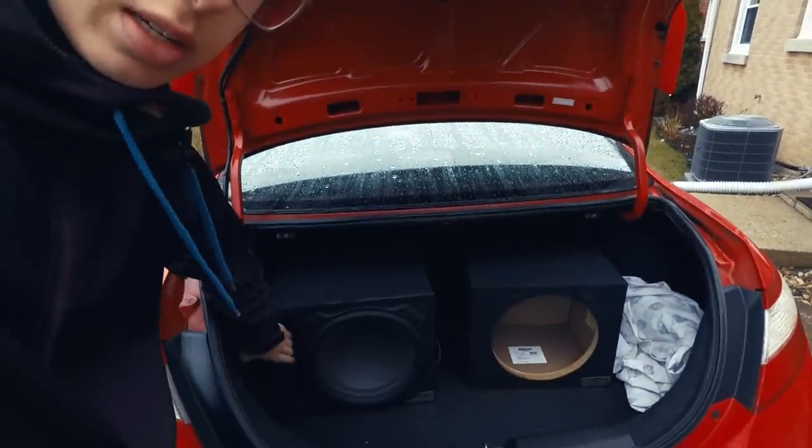One downside to a sealed box is that they are actually less efficient because it takes more power for the amplifier to move the subwoofer. To explain this, I'm going to go into a little bit of physics. If you think about a sealed enclosure, the subwoofer has an airtight seal with the box — no air is going in and out like in a ported box. When the magnet for the subwoofer pushes that cone outward, the air inside the box is then low pressure and it's already trying to pull the subwoofer back to its original position. So it does require more power to make that subwoofer really move in and out. The result is a much more punchy sound — it's very quick and sounds a lot more collected and accurate because of that.